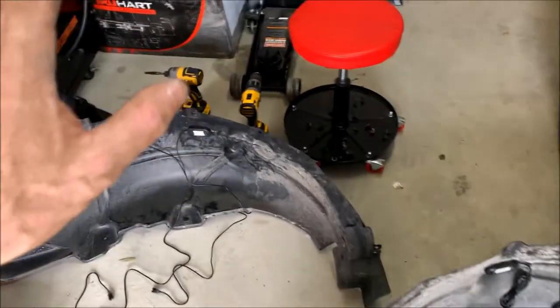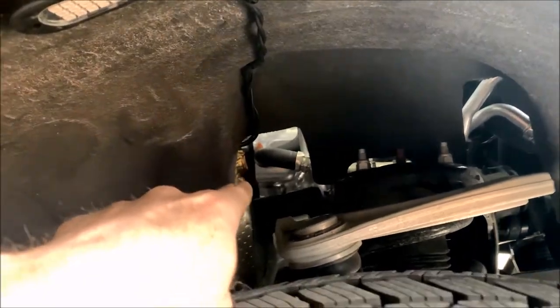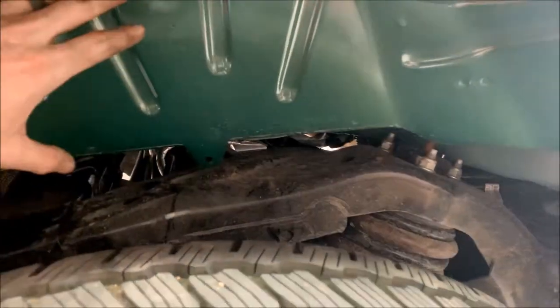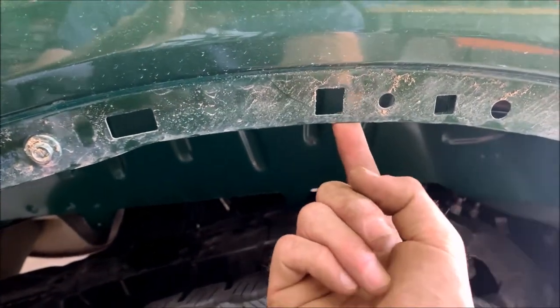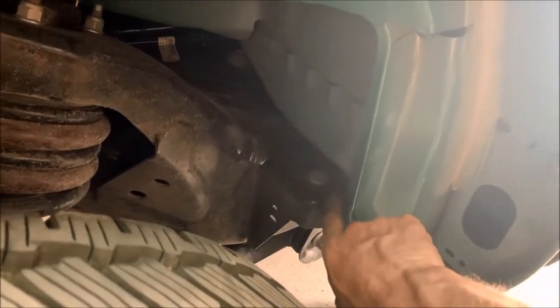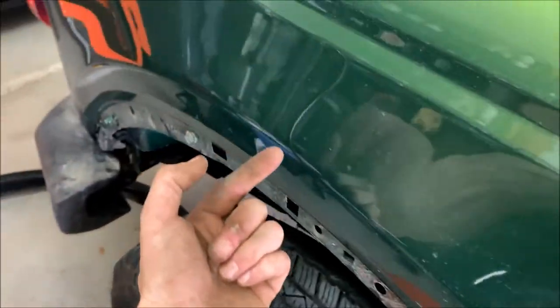All the lights are mounted up on the rear fender liners. I'm not going to drill any more holes in the rears like I did for the fronts — that approach was for shooting straight back, but the rears are a little different. Since I'm running my wire to the front, I'm not going that way, and all of this is completely blocking it anyway. So what I'm going to do is, once I get the fender liner back on, take the wiring and tuck it in between the fender liner and the body, then run it behind the fender liner all the way down. I'll get both fender liners back on, tuck the wires in between the liner and the wheel well, and then work on running the wiring to the front.